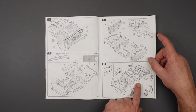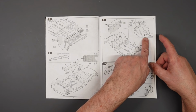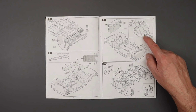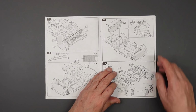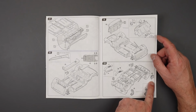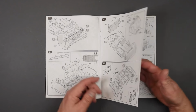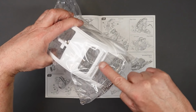And then we've got the duct here for fresh air going in. And then we've got what looks like a fuse box or a relay. If it had a dynamo, that would be your relays in there. Modern day cars with alternators have the relays in the back of the alternator. So remember, this is drum brakes all round, so you've got your brake back plates going on there. As I say, that piping going in, and then we've got the main air duct going into the engine there, so that's your main air intake. And that's fed in from the grills across the back of the body here.